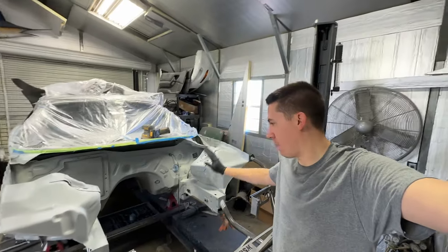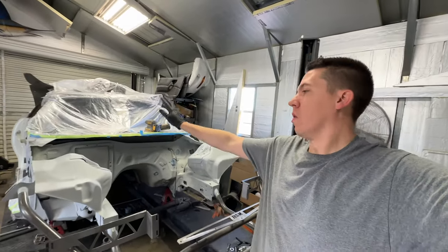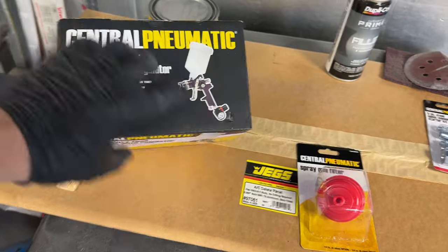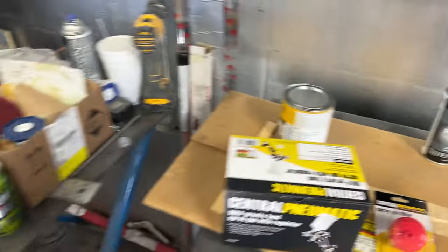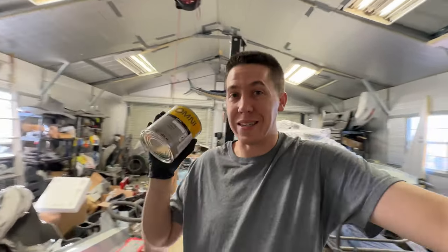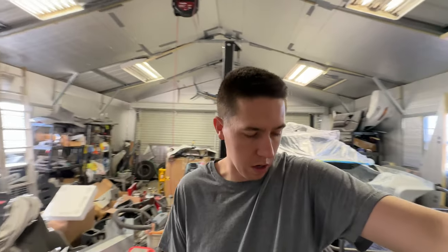Good morning everybody, I'm back over at the shop. I worked for like another two hours after I turned the camera off last night, just going through and working with little pieces and spots that were bugging me - there was a little pinhole up here that I re-welded and then had to re-prime and re-sand. I've gotten everything cleaned and wiped down this morning and the shop is warming up. I actually picked up one of these trusty little Harbor Freight purple guns - I think this thing was like 30 bucks with the regulator. Trevor from Motion Island told me to make sure to grab one of these little filters and some connectors. I was going to go with a nice gun but Trevor said just use that one, he used one for years and it worked perfect. I also picked up some of this from a local paint shop called DNS - this is an Omni MTK 2K urethane, a single stage of the factory white. I'm planning on spraying it with the exact same color - I'm sure it'll be a little different but it'll be in the engine bay so nobody will even notice.